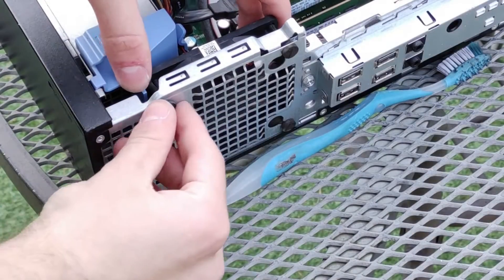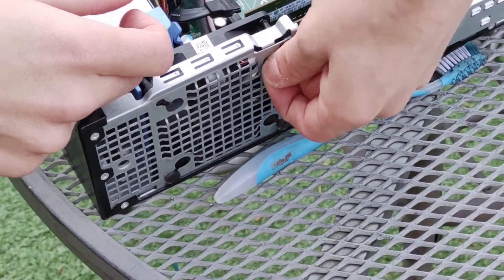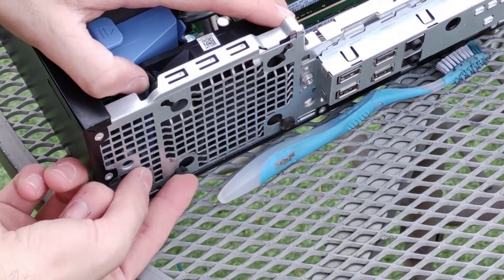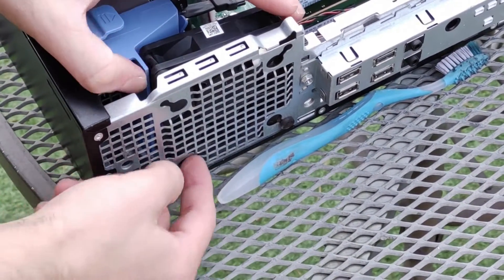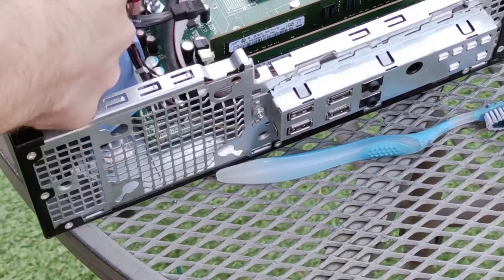You may also want to clean the intake fan. This can be done by pushing the rubber mounting piece into the larger holes in the chassis, which will loosen the fan. The connector for the fan is located next to the power supply and needs to be disconnected, as well as the cable being unhooked from the cable management clip on the blue shroud.